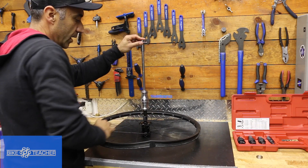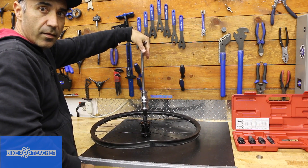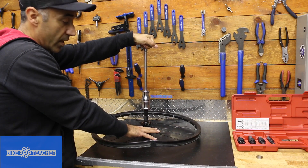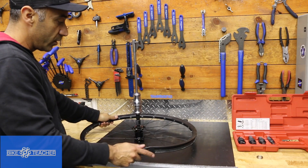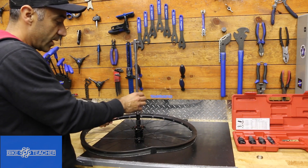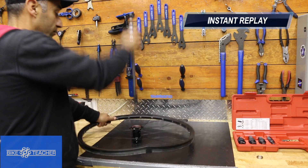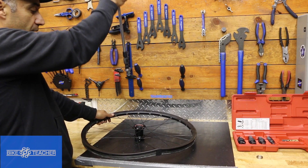Remember, fingers up here — have them clear. You don't want them hanging down here. So if you had a second person to hold this wheel down and stabilize it, great. I'm going to one-hand it — I'm going to hold the wheel and slide this up as hard as I can and see if I can dislodge it. And there it is.